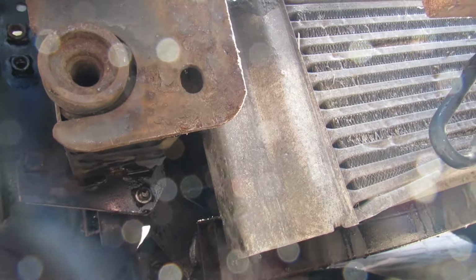So we're actually going to remove the water pump, and John's just got the sockets we need. They're all Torx. Just remove this pipe for the side. They're female Torx, and you need the 10 and the 12. There's a couple of big 12s, one there. So the 10 bolts are basically here, here, here, here, here. That's not one. That's one, and that's one. The reason why this is so oily is because we had a problem with the injectors. That's why there's stuff everywhere. That's another story, in another video.